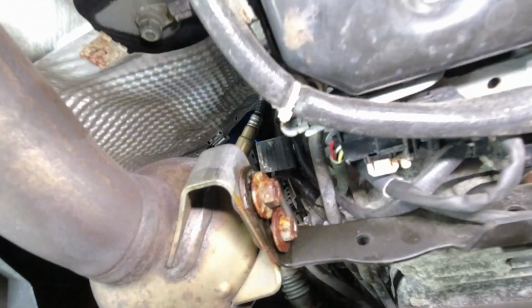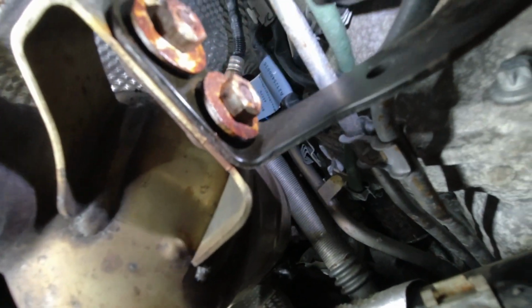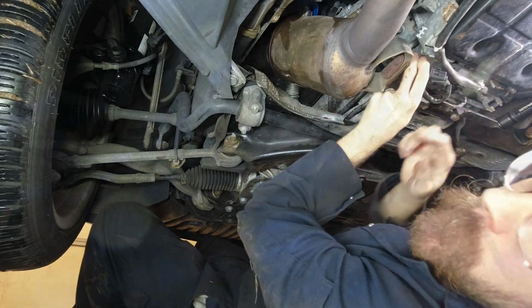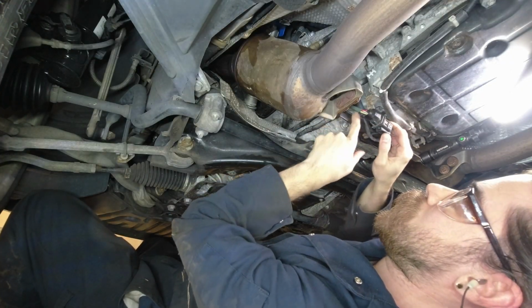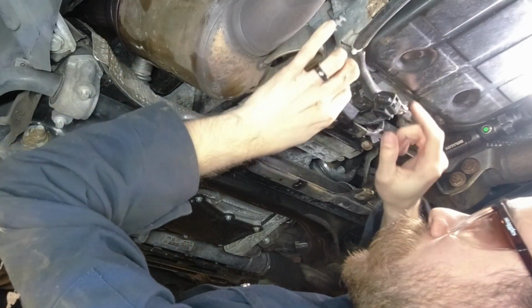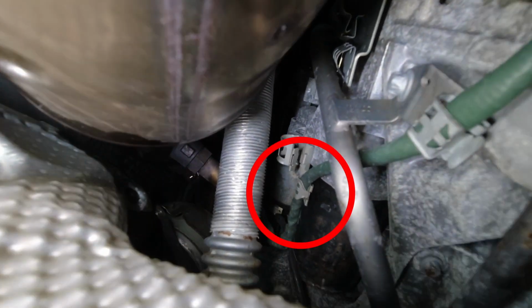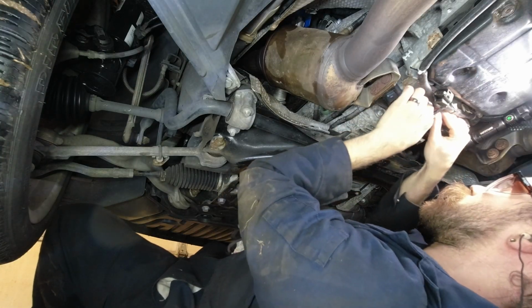Work on the connectors. So we have our green wire goes to the sensor back there, our black wire to this one. I think it's these. I'm gonna double check, but it should be this connector and this connector. So I'm gonna undo those. And a holder here. So right here we have the green one. And this goes into that holder up there. I'm gonna try to feed this out. Here's a little clip. There's a clip there, and then further up over there. And those two are the ones we have to get out of the way. The other O2 connector is in the way.